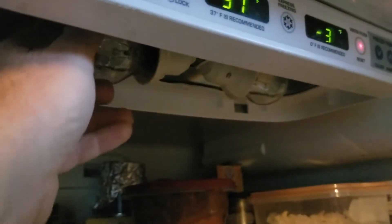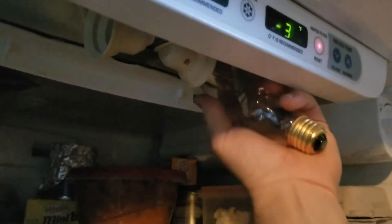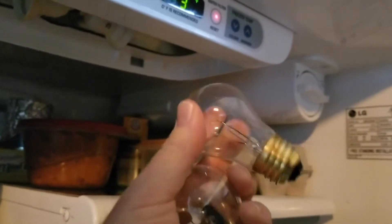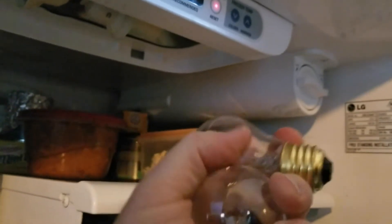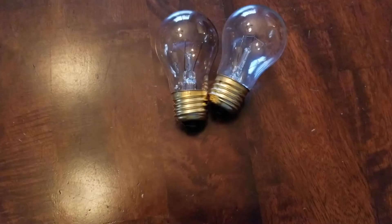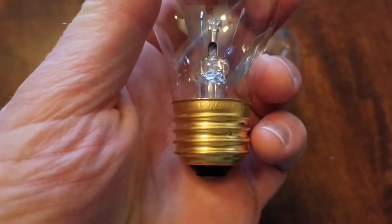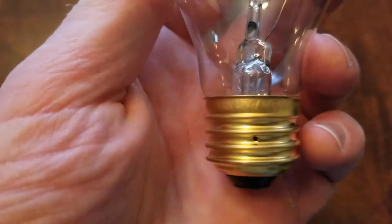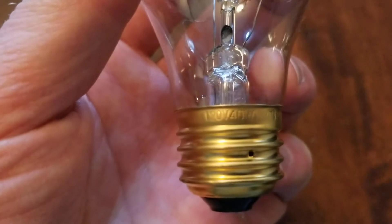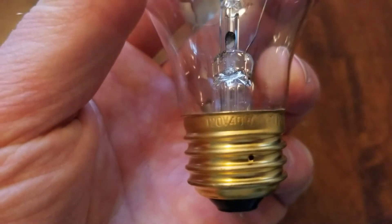This isn't just a simple light bulb — you actually have to unscrew these. I'm going to unscrew both sides and pull them out. We're going to have to find the specific model numbers because these are obviously a little bit smaller than your standard light bulbs. Our old bulbs will have a little label where you can see the type of voltage as well as the wattage that you need. I'm looking for a 120 volt, 40 watt bulb — you can just barely make that out on that little serial number right there.